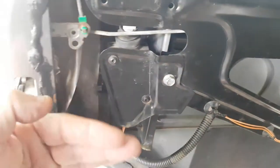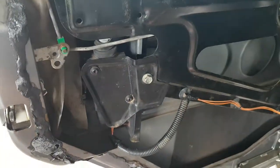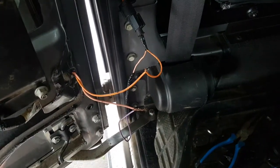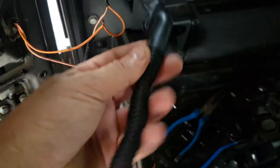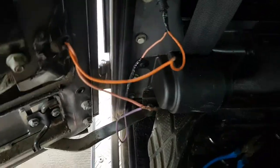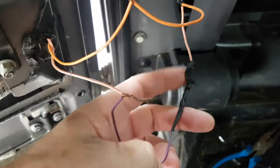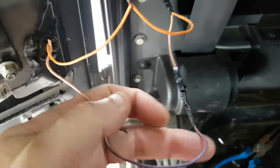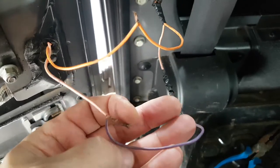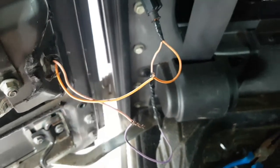A couple of these bolts and that one there, then you can pry this open a bit. I took this off and had a look. In the end it turned out to be a broken wire that's inside this boot that goes between the door and the body. When I took that all apart, I saw that in the past one wire had gone and the people in the workshop had spliced it together. This time another wire had broken — it gets pinched in the door.